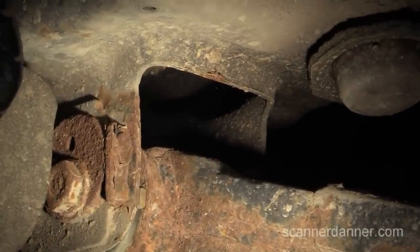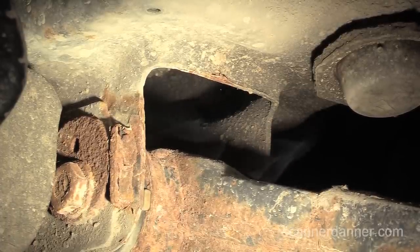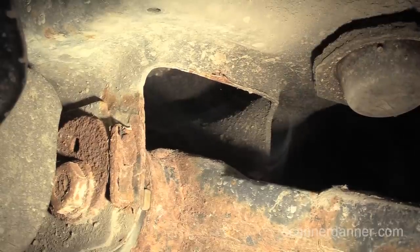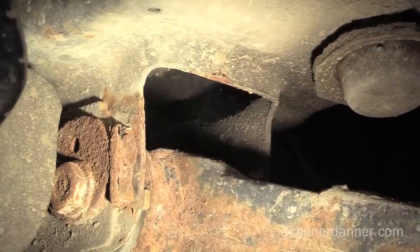You can see it — smoke pouring out of the frame. I was correct: that is our vent line. For us to do an actual evap leak test on this properly, I really need to close that vent off. We can do it multiple ways, but that is going to be key.